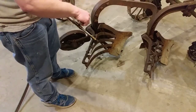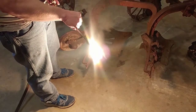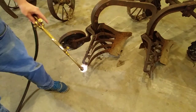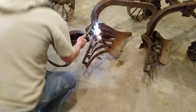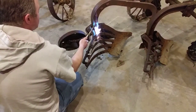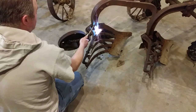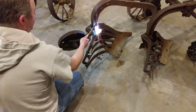I don't think penetrating fluids are going to do it, so I'm just going to use a little bit of heat on the nut. The whole idea when you're heating something up is to break the rust bond on the fastener. I'm going to heat up the nut and bolt here, get it orange hot, and then let it cool. Nine times out of ten, after you let it cool, they break pretty easy.